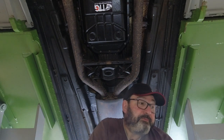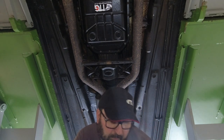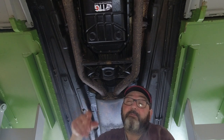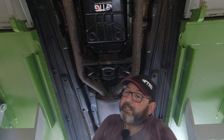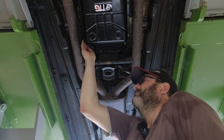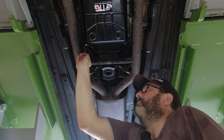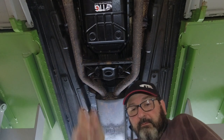You rejoin me after I've put three and a half litres of oil into the gearbox and then it started to overflow back out, so I've cleaned up a little bit. There's not too much point in being too fussy because it's going to spill again. What we do at this stage is put the filler plug back in and nip it up with the 8mm allen key. At this stage, that part is done.